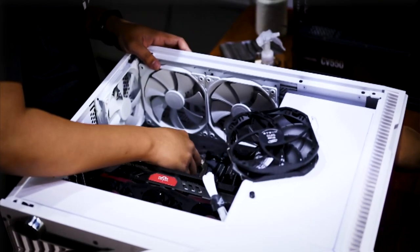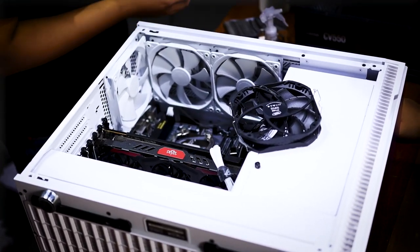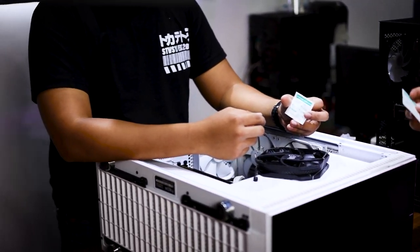Okay. We're cleaning off the thermal paste we applied earlier, and then we're going to apply the liquid metal. So how do we apply this, Jay? We apply a very small amount, as little as possible. Initially, we should clean it with the alcohol wipes provided in the pack. That's the first thing we'll do. After that, we apply the liquid metal. It should be pre-spread before we mount the cooler. We'll also put liquid metal on the cold plate of the cooler.